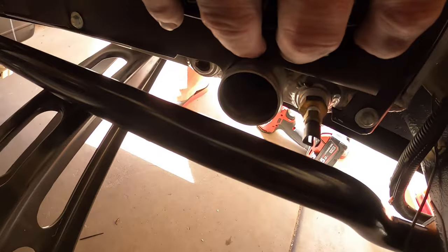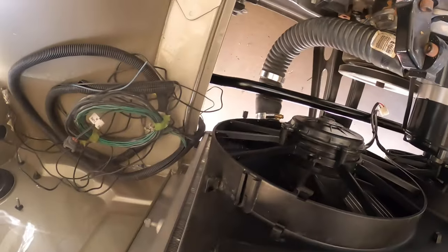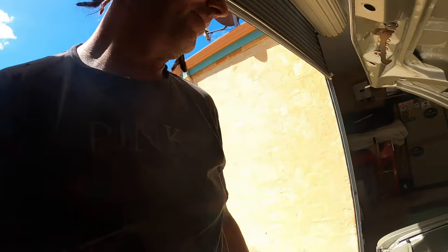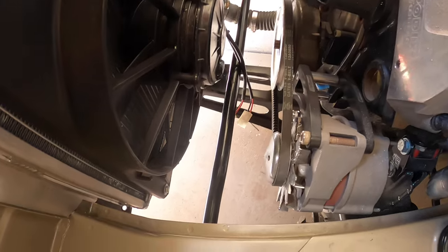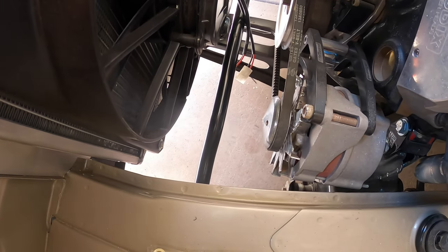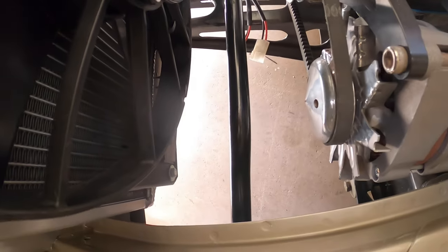I'm going to cut jobs off the list. We thought we were going alright until we have a look down there — the bottom radiator hose is going to foul right there. I don't know what I'm going to do. Not looking good at all. Always a bloody problem. I think I've put that sway bar on wrong and that bend needs to be facing down — unless that's supposed to be down, which could be the case because there's actually plenty of room here.